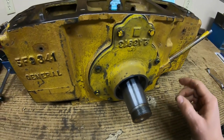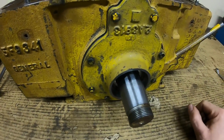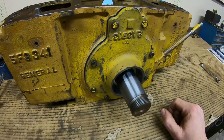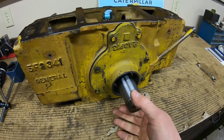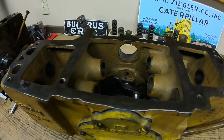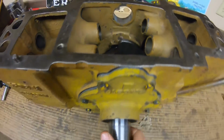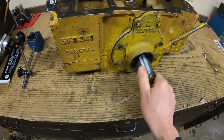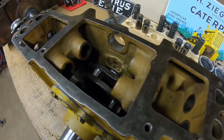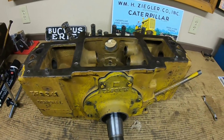And after the gaskets are clamped with all of the load from the bolts for a while, they are going to compress a few more thousandths. That would probably still bring us down to 10 to 12 thousandths range. I think we've got a pretty workable system here. Good spin on the crank, nice and smooth. No scraping. So, all right, I'm satisfied. Might as well dowel these bearings in place, make them permanent.